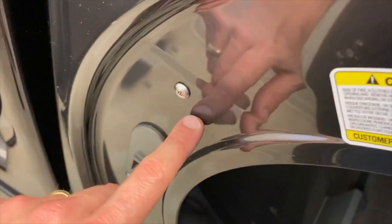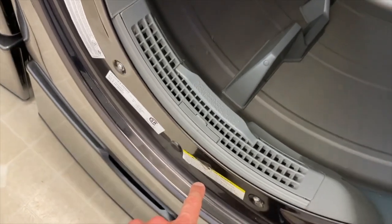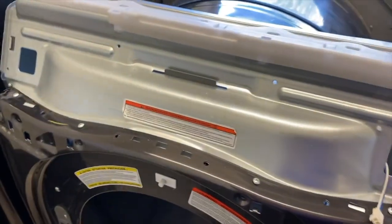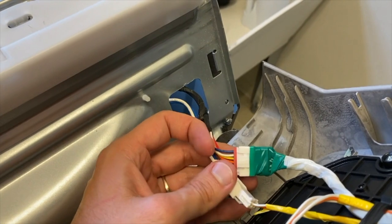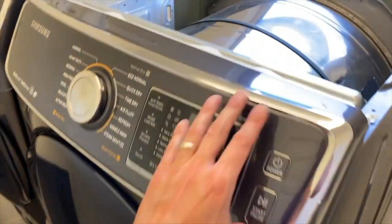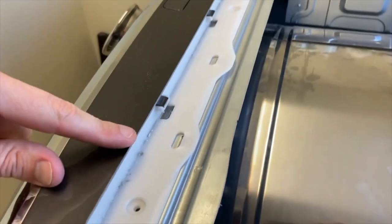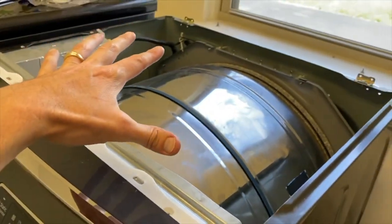Re-secure your four upper Phillips screws. Open the door and add four additional screws — the lower two had washers on them, if yours is like ours. With the control panel back in place, re-secure the right-hand connection point. Be patient as you realign your control panel — make sure all your connection tabs are properly in place and secure.